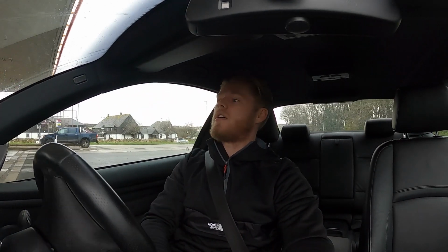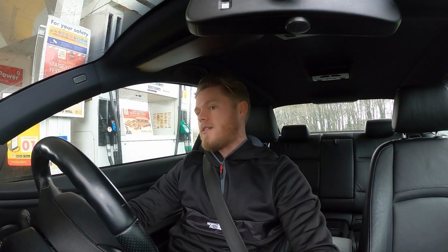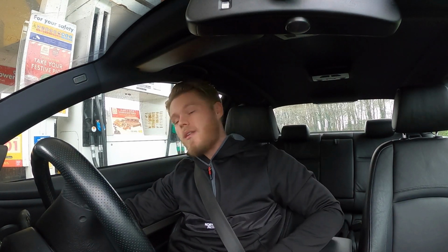it has caused a lot of issues, and it's a very, very expensive fix, as carbon and soot can then enter your combustion chambers and score your pistons and rings, I'm pretty sure, which obviously leads to engine failure. So it's something worth getting rid of while you can. And on all the forums, everyone suggests please get rid of your swirl flaps straight away. So it's a must.